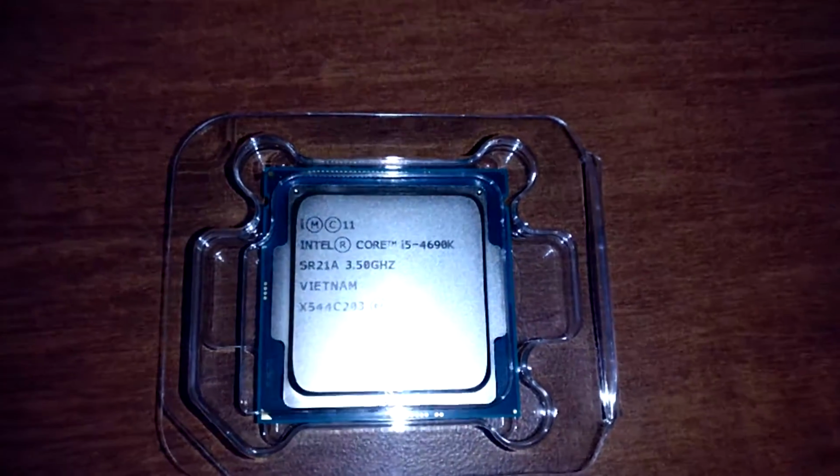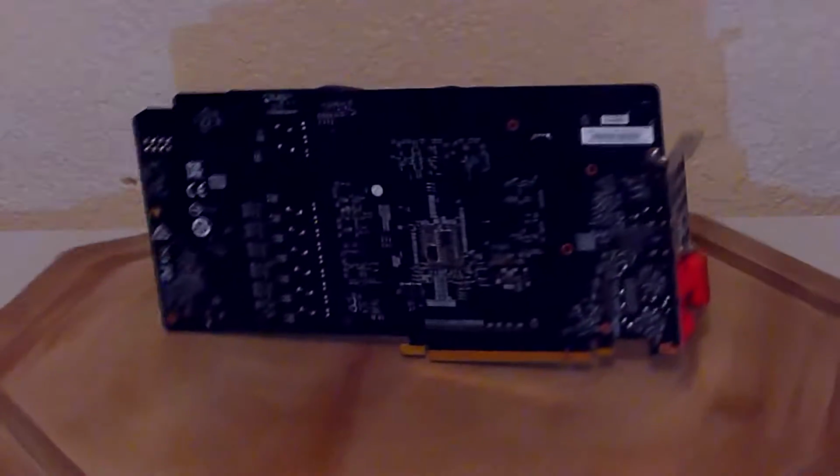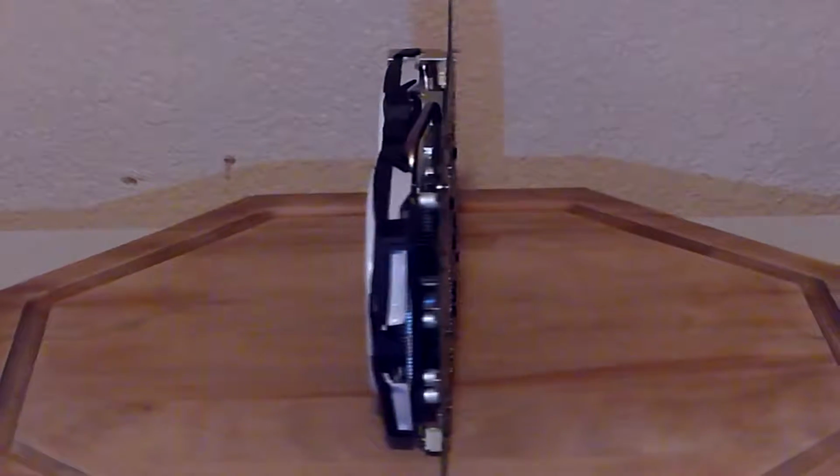When it comes to your graphics card, you have 2 main options. If your CPU comes with on-chip graphics, sometimes called integrated graphics, or sometimes called an iGPU for short, and you won't necessarily be using applications that heavily leverage graphically intensive tasks, then you may not need to explicitly buy a separate graphics card, and you can opt to plug your monitor into your motherboard directly, which is bringing out the graphics chip that's on your CPU die. But for those of you who will be playing 3D video games, video editing, or encoding, etc., or those whose CPU does not include onboard graphics, it's nearly a necessity for you to purchase a dedicated GPU.